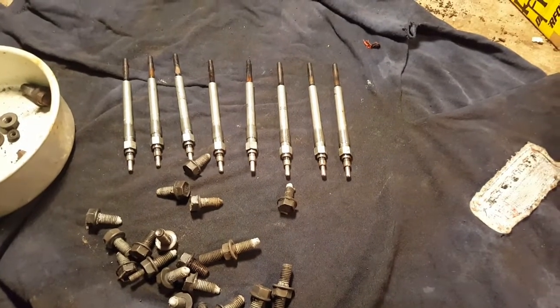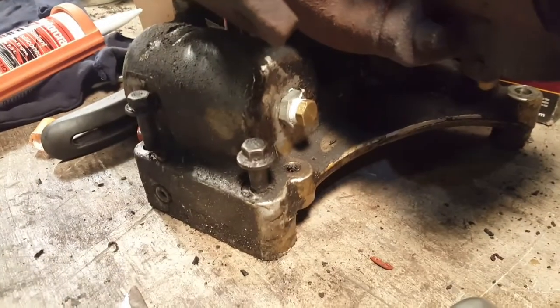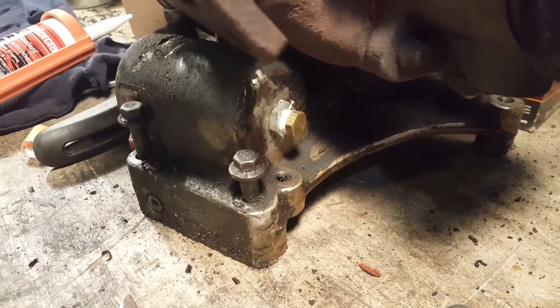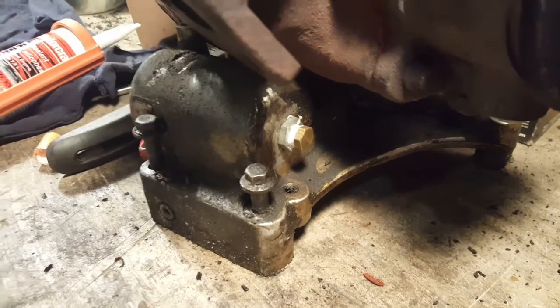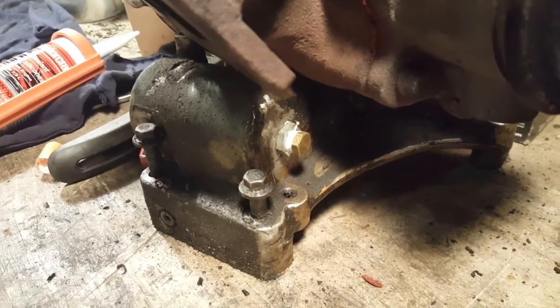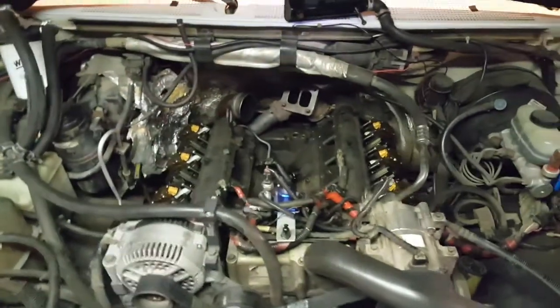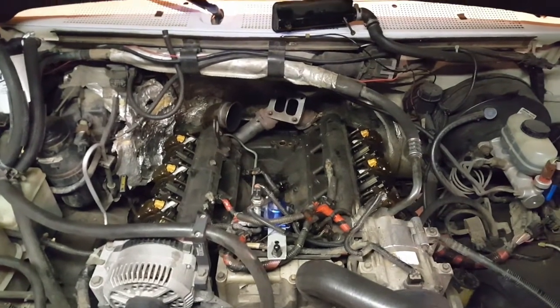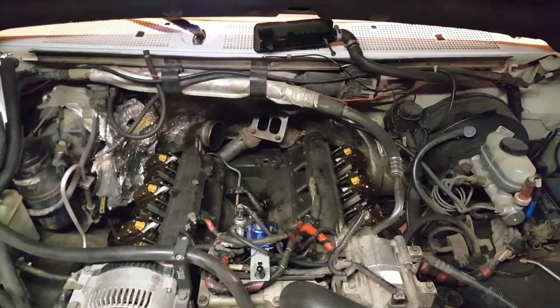These are Beru glow plugs — I think that's the OEM manufacturer for Motorcraft. Good stuff, ZD11s. They work well, so that's what I'm going to go ahead and put back in. Got some things together here. Getting the turbo cleaned up. Capped off the rod from the exhaust back-pressure valve — it decided to start oozing oil. Best practice is just to cap it off. I tapped it out for a quarter-inch NPT and plugged it. That's kind of where we're at — start putting this thing back together and see if we can make some smoke.